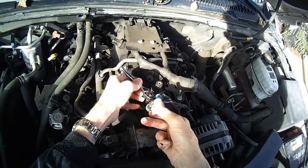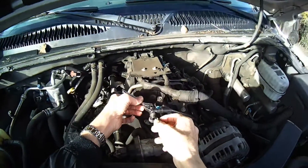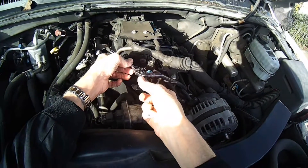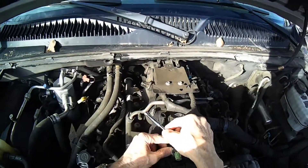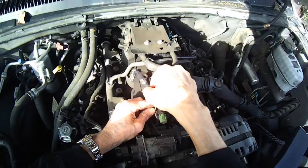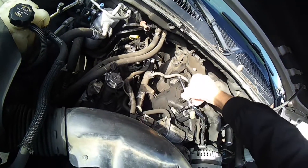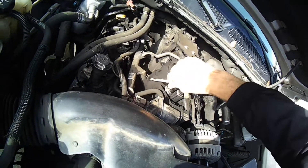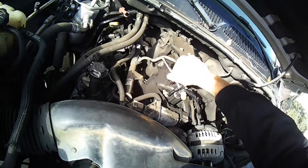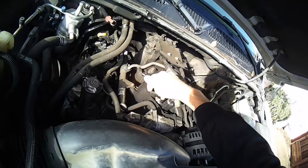There's a piece here where you can bleed off pressure or do a pressure check, just by pushing on that little pin. There's probably also a way to do a vacuum check to see if it's functioning. My guess is this is the culprit because we had all that built-up pressure on the tank — it wasn't the gas cap. They called it a gross leak, but really it was the opposite: it wasn't able to vent off those fumes. There is another culprit that could cause trouble — it's down underneath the car above the transmission housing. There's a solenoid down there too, but the gas cap is the most likely fix first, this purge valve second, and that solenoid third.